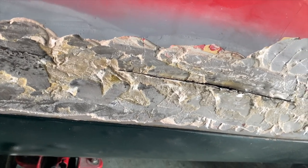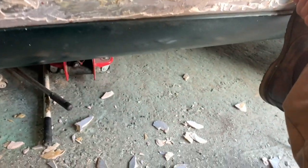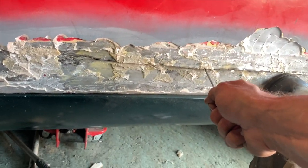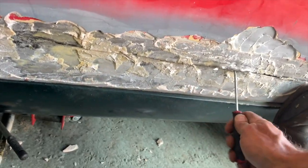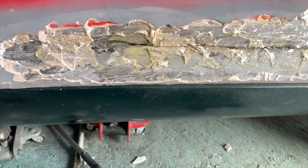I'm still going to need a lot of filler but it should be a lot less. I don't know if I've just made this a lot worse for myself, but this will come out further. So I think that door — the original skin there — is more or less hanging where it should be, although it's not very straight any longer. And this one underneath needs to come out. So I need to pull the bottom one out. What I'm going to try to do is pull the bottom one out down here somewhere, weld that together, and then come over here and do it like that. So we'll clean it up a bit and then have a go at that.